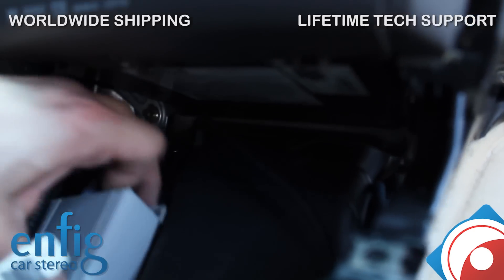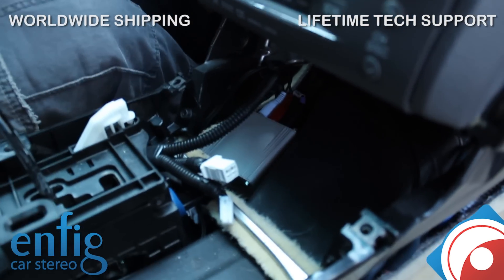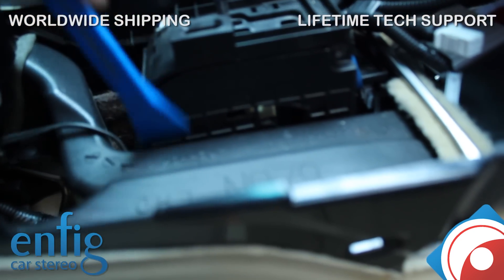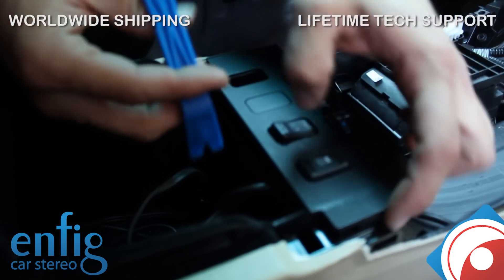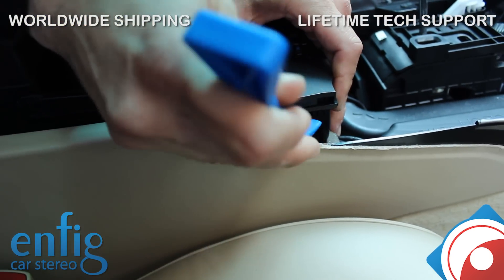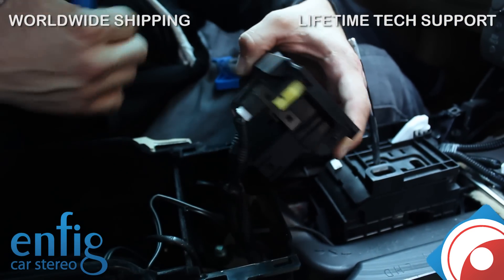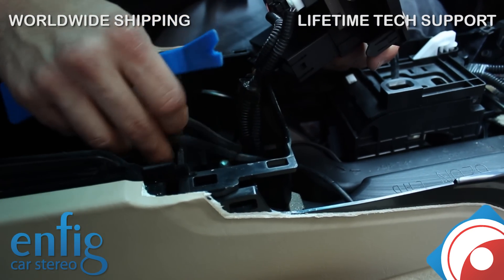Once you do that, the box goes right here. Tuck it right there. Then I ran the iPod cable through here and the AUX cable through here. Make sure when you do it you tuck it down so it doesn't come up. Once you get over here, just pop up — this pops up. Do the same thing on the other end. It's just those two little clips on each side. I dremeled this hole right here — just used a little half circle — and put both holes right there.